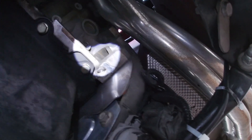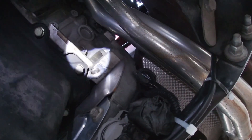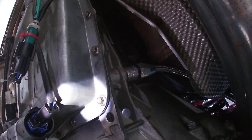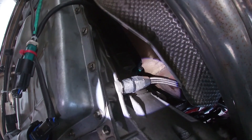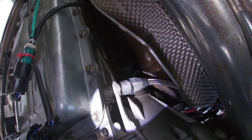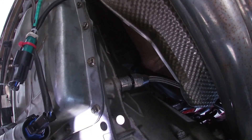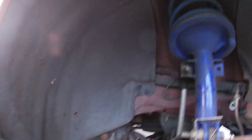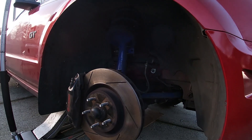There's also an inspection cover up there. The lights are kind of on it, it's really hard to see up there, but the inspection cover I needed to put back on. And then the dipstick — it was leaking just a little bit when it was on its end, so I just went ahead and tightened everything down and I applied some silicone to it, so that'll dry up and hopefully stop any type of leaks. All in all, that's pretty much all I had to do. I also got all the cabling that was behind this fender liner all wrapped up and got the fender liner in there, so that's pretty much good to put back now.